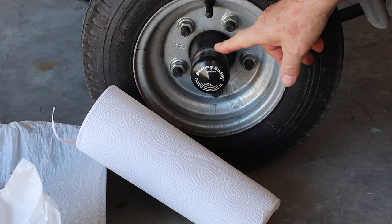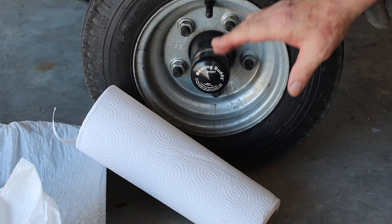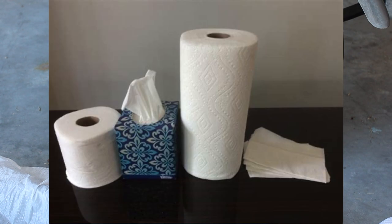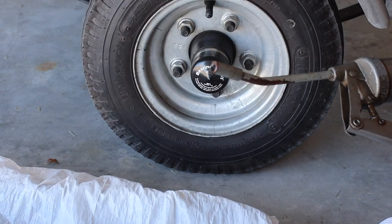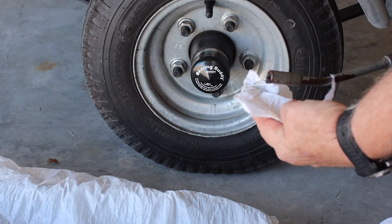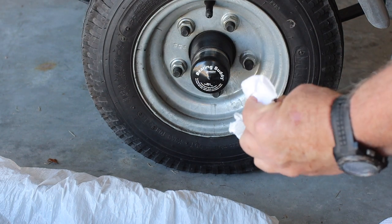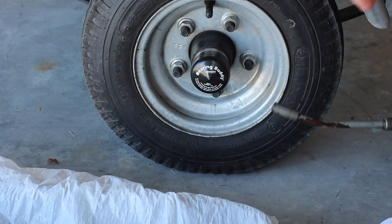These are bearing buddies. We're going to grease the bearings that are inside the axle — you have to do it on both sides. This is filthy, so make sure you have a lot of paper towels. This is my grease gun. You can see that grease is sticking out of the end — it oozes out of this gun when it's not being used. So I clean off that little bit of grease because it would have captured dirt over time and I don't want to push that into here.